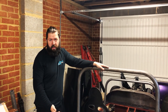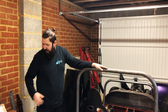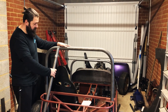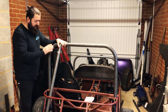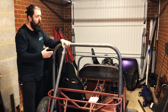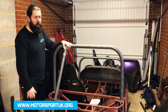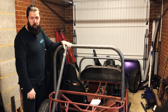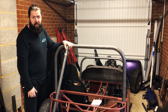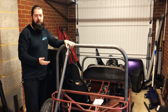The main thing is it needs to be six-point. And one of the other things is that from this we're gonna have some rear stays which will sort of poke down into the corners — but the angle of this needs to be 30 degrees, or no more than 30 degrees. All these regulations are on the MSA Motorsport website, or the blue book as they call it. When you get your license, you'll get all of that information, and it's all on the internet readily available. Those are the regulations you need to adhere to.